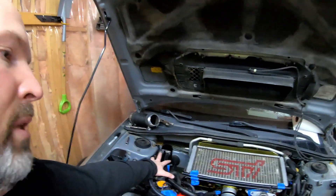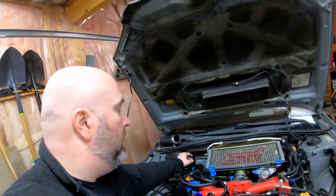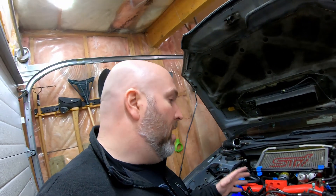If you guys watch the channel Super Beast at Edmonton, you'll notice that when he did his catch can it went down here. Now with a JDM car, all the steering assembly is on this side, so he couldn't put it up here — he had to put it down here. This is a USDM car, so I was able to fit mine up here, right by the turbo, so it's going to keep nice and warm. Now, this isn't a Perrin or a Cobb system where it's an oil return using an air oil separator, but I want to try this one first — number one, to see how much oil I was catching, and number two, if I decide to go down that route, I can always reuse the existing lines we've plumbed in here. Now that we've got the plenum back in, it would have been way harder to do that work getting down to the PCV valve. Really happy with this install and cannot get over how well it turned out.